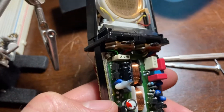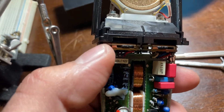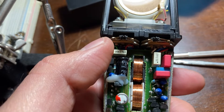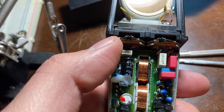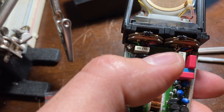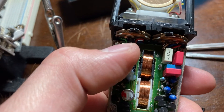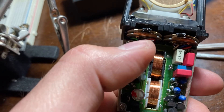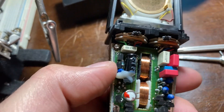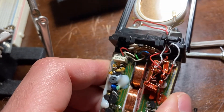Make sure not to have too much pressure applied to these little wires that are connected to the high-pass filter and the pad, because they're definitely fragile. I tore one off, so I had to solder it back on. Definitely be careful with those things.